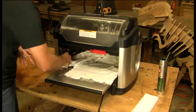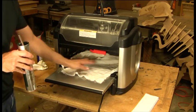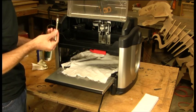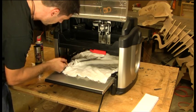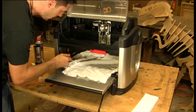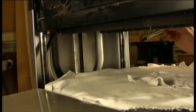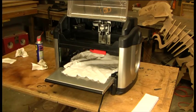At this point we're clean, and we can go ahead and apply our lubrication to the corner posts and to the lead screws. This is fairly straightforward — crank the head up again just like at the beginning. We like to use a little brush to get into places your fingers can't usually reach. You simply want to put a very thin coat up and down each post, trying to get in from the back if possible. You don't want to leave too much on it, because excess grease will attract dust and you'll have to clean it more often — but you do want a nice thin film of grease.